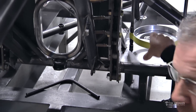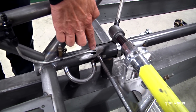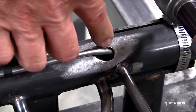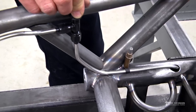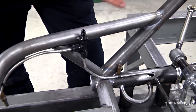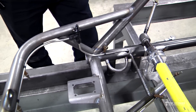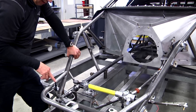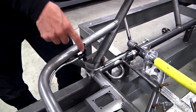We're going to run it down the outside here and dink it right into the rear crossmember, then right up the right lower frame rail to get it to the front of the car. We pop out here — same as the brake lines, we've got a piece of conduit in there, 5/8 tube, about an inch and a quarter long, welded around the end. We pop out here with our fire bottle line and come up to the front of the engine. It's important to have a fitting on each side and to get it up in front of the engine, so that if we have a fire the agent is blowing back onto the engine in the header and valve cover area — that's most likely where the fire will be, around the intake or any fuel line.